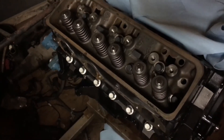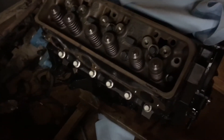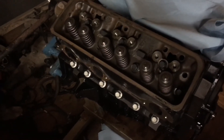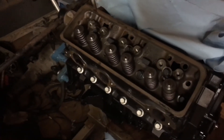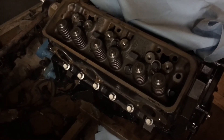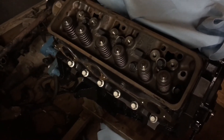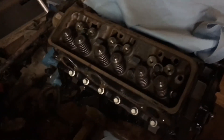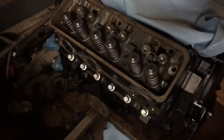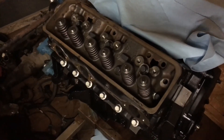Make sure you follow the sequence and don't skip a bolt. I've taken heads off engines I've rebuilt where a bolt was finger tight — whoever was torquing that head down missed a bolt in the sequence. When you're going through these bolts, have a system: check them off one through thirteen as you go. I do all 13 bolts in one session without stopping — I don't do three bolts, go eat lunch, and come back. I move from one bolt to the next knowing I just did the previous one, making sure I'm on the right sequence.